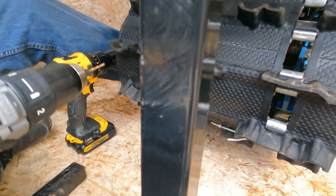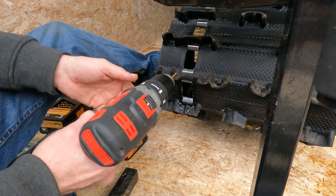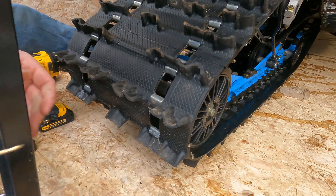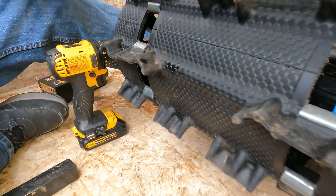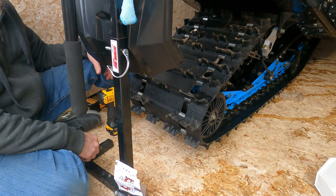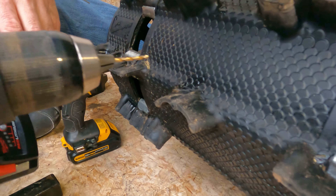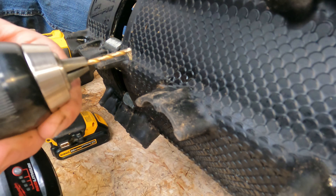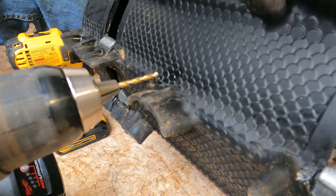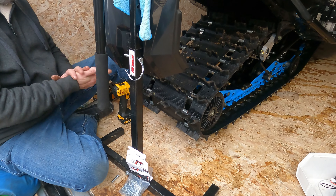So it moves around. I'm going to advance the track a little bit. You do have to have a jack, otherwise this would be very difficult. Our next set is actually the very end of the triangle so we have to drill here. The lugs are obviously very strong to take the beating they do, but the drilling is important. I chucked the drill bit up inside the drill just long enough that it won't pierce the back of the track, so I don't have any chance of a tear-out or damaging the track itself.